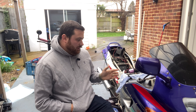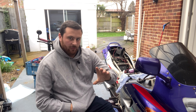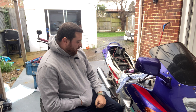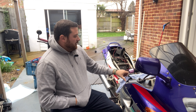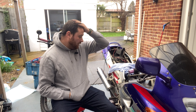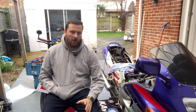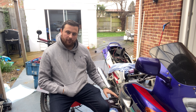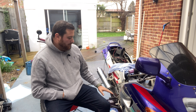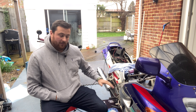Hello and welcome back to another episode of All The Gear Some Idea. We're back on the ZZR - I'm not entirely sure where we're at in regards to videos being released for this, but I do know it's cold. There was a problem with the bike not starting, which we got to the bottom of. The oil level is way overfilled, and that's due to excess fuel being put into the engine and going into the sump, lifting the oil level up.